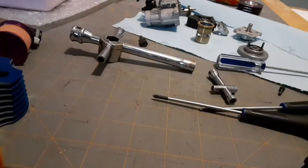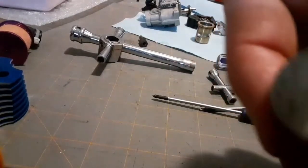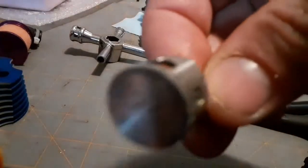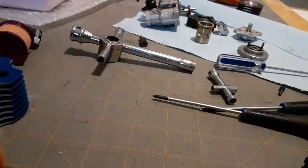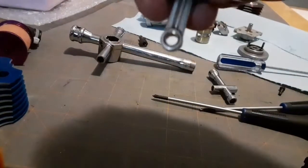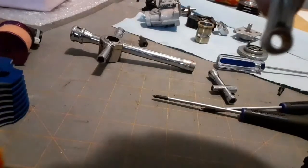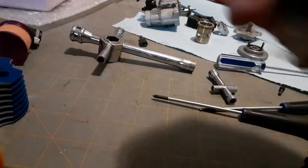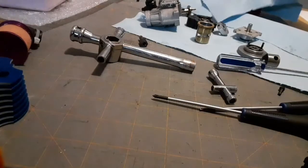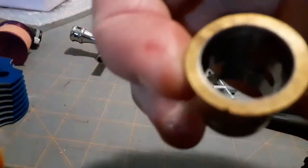The cylinder is tapered — at the top it gets narrower — so there are no rings like in a car motor. One thing you have to be careful about when putting it back together: see that groove? At the bottom of that groove on the rod there's a hole. That hole has to face the crank inwards, because that's how oil gets into that brass bearing right there.